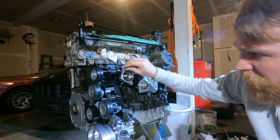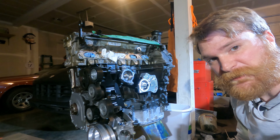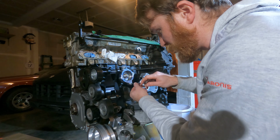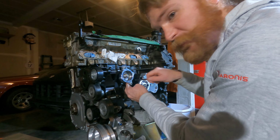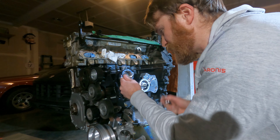Insert the screw at the bottom, at the top, tighten them down. Now keep in mind that this is all plastic and aluminum, so don't tighten too hard. You know, just enough to make sure that it won't turn anymore, but don't torque it all the way down. That seems like a great idea if you want to break stuff.